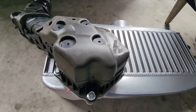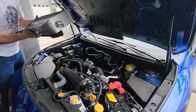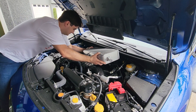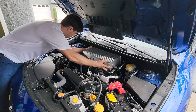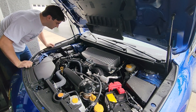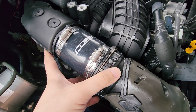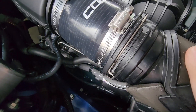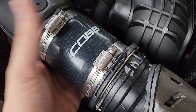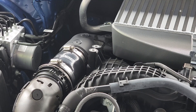With our new Cobb intercooler fully assembled, we're going to begin to install that back into our engine bay. Make sure that your charge pipe quick connect portion is fully inserted into your charge pipe and that the clip goes down fully on all sides. Do double check that your coupler is fully inserted and it won't come out easy. We'll now loosely reinstall back the bracket we had taken out.